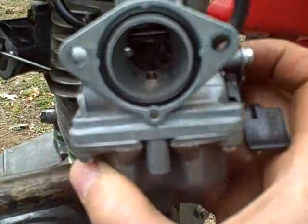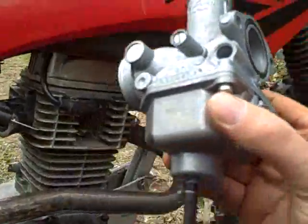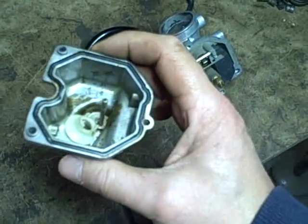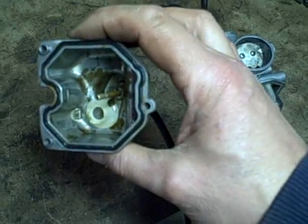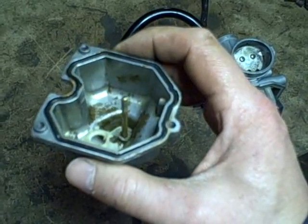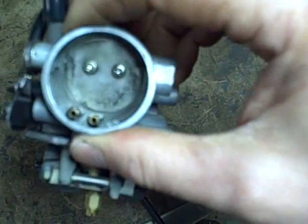This actually doesn't look bad, but looks can be deceiving. Let's take the bowl off and see what kind of crud is in there. There is a little bit of crud — some stuff stuck up in the upper part of the bowl. Doesn't look that bad, I've seen worse. There's some residue, some old corrosion in this bowl, but the actual fuel in the bottom of the bowl looked fairly clean. The intake side looks real dirty though.